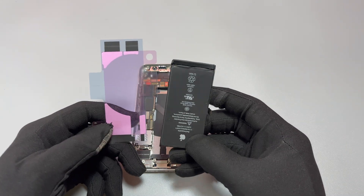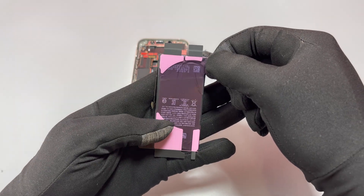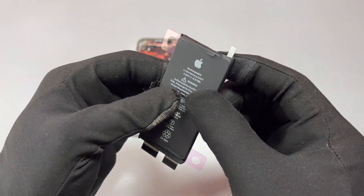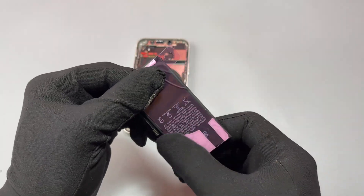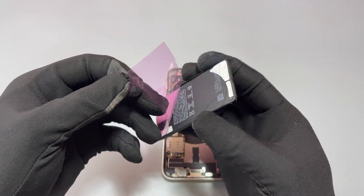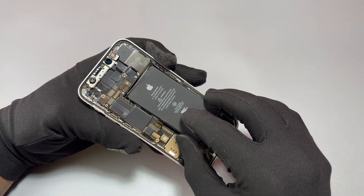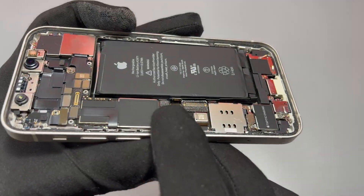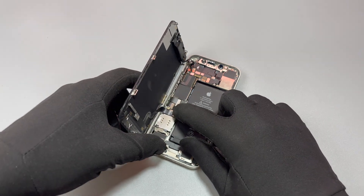When the battery is out, you need to clean everything — all the remaining glue that is still attached to the frame of the device. The replacement battery should come with some new double-sided tape that you need to attach to the back of the battery. You need to have the shorter double-sided tape on the top of the battery and the longer double-sided tape at the bottom, following the same dimension as the charging coil on the back for wireless charging. Make sure you apply a little bit of pressure on the back of the battery for the tape to stick. After that, remove the protective film and adjust the battery so that the battery cable is aligned with the flex cable connection. Do not apply any pressure on the battery until you have aligned the battery cable, then you can start applying pressure for it to stick to the frame.